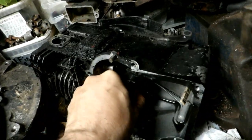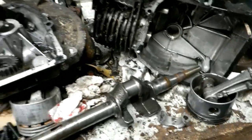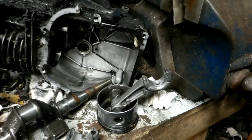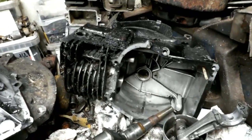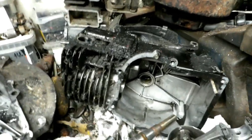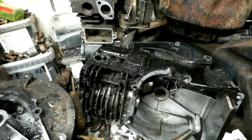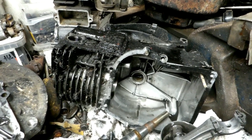Basically what I do now is disassemble the motor and let it dry out. Then you end up with oil and no water, so you re-oil the cylinder, put it back together, put it up in the shed. That's the inside of a very dirty '96 Briggs 3.5 horse — and the outside of the shed.